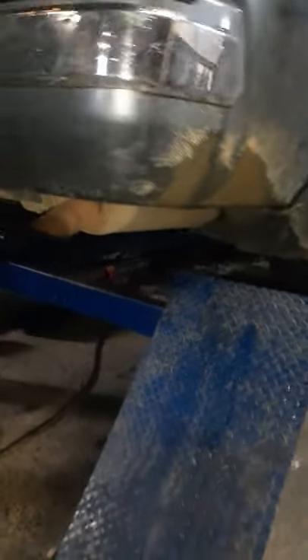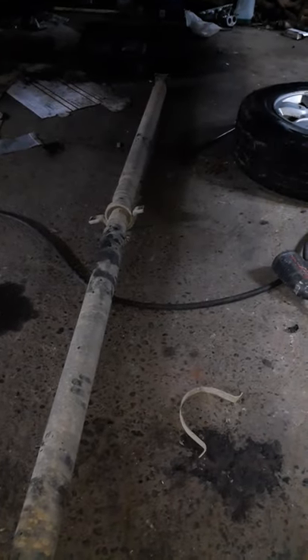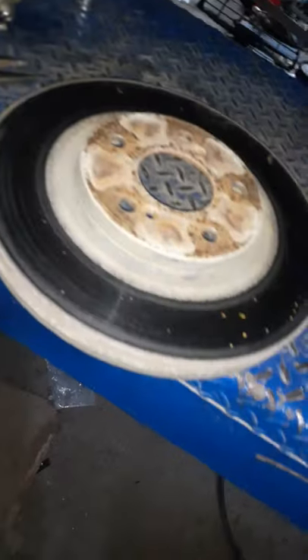We're gonna show off some Honda Ridgeline shenanigans — 2007 Honda Ridgeline. We got the driveshaft issue. Short story: took it out to diagnose, we have major vibrations coming into this vehicle. Besides warped rotors and shimmy on the pedal when you brake, we got what feels like a wheel trying to come off. This wheel bearing is toast, so we're gonna do the wheel bearing.